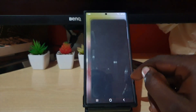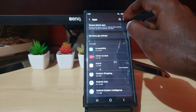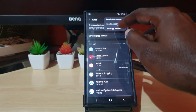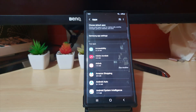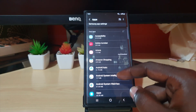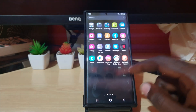Another thing to try is going into Settings, then Apps. Use the search function and search for 'USB settings.' If you don't find it, it may be hidden under system apps. Once you find USB settings, go ahead and clear the cache and clear the data, then reboot your device. That can resolve the error if it's software-based.